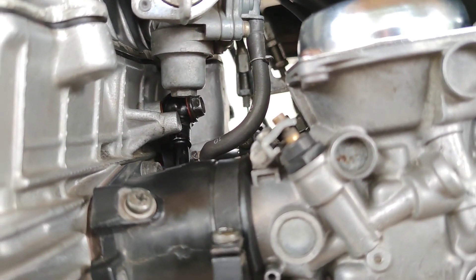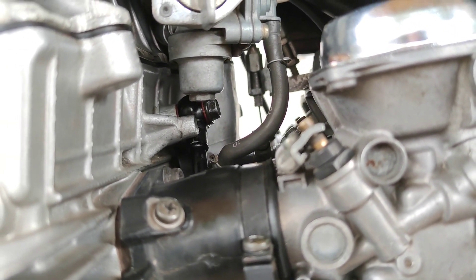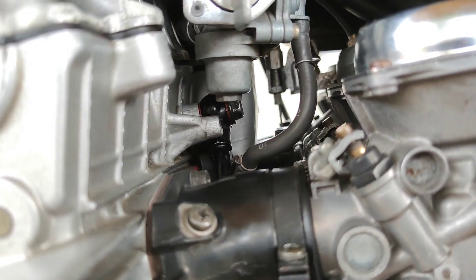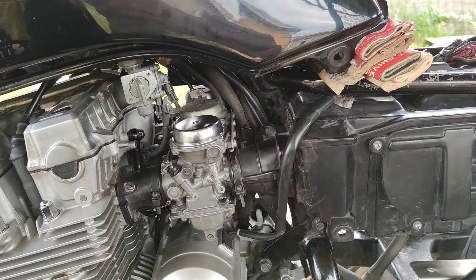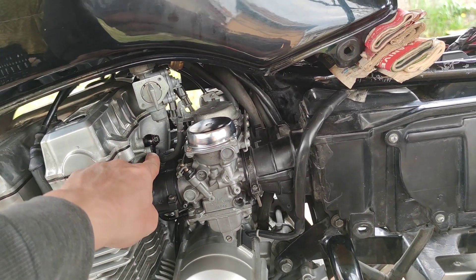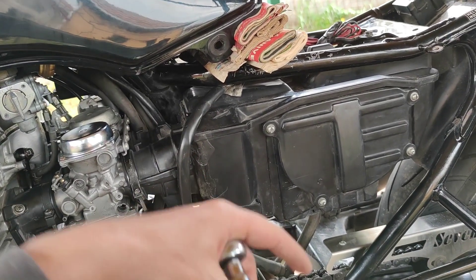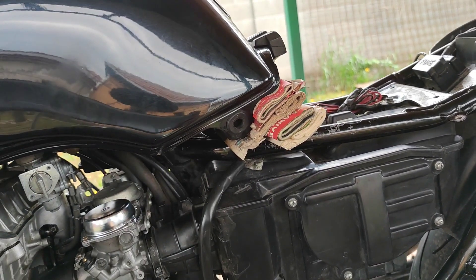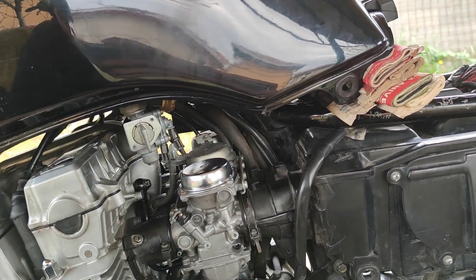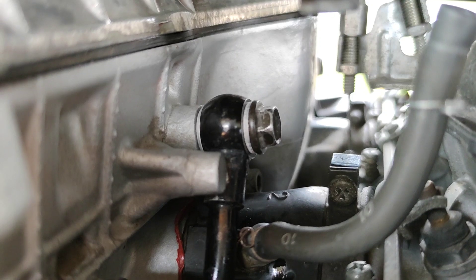The burned copper washer trick didn't work for this side — the other side is not leaking but this side is. So we're going to put some new aluminum washers. This time we only need to work on this bolt and the one from the other side going through the pipe. I've removed just the side panels from both sides, opened this 12mm bolt, and put some paper under the gas tank to lift it up a little bit to have access here. The new aluminum washers are almost tightened all the way back.